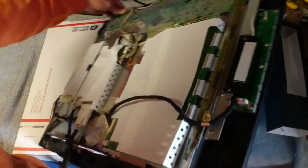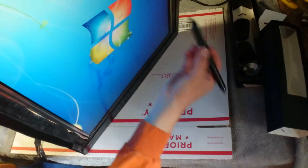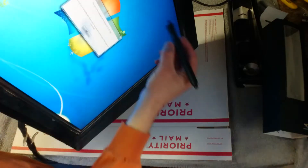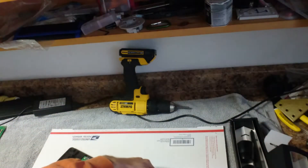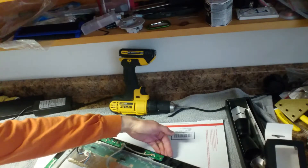So we got that in. This is my test model so the front of the screen doesn't look that great because I did a rough job repairing it. I'm just going to put it on its side and take the pen over. Oh, that's the bad pen — as I suspected, it does say this pen is not compatible with the Cintiq. So you must use a compatible pen. With the compatible pen — boom, looks like the digitizer has been repaired. We are good to go. This is going to ship back today. The way you can tell really quickly is that right up here is the status light. I just make sure that the status light is blinking when I'm tapping it. Most of the time I don't flip it over — I'll just test it from the underside and watch to see if I see the blue light blinking. And if it is, we're good — I have fixed it and we can ship it off.